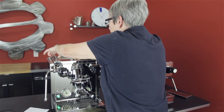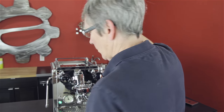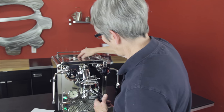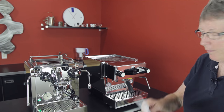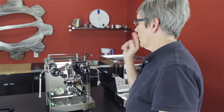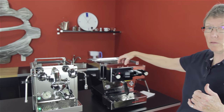On this one with the PID, this is where you switch the water source. True double boilers: 1.7 liter on the steam side and 0.58 liter on the brew side. Copper boilers with brass end plates, insulation wrapped. This has an E61, which keeps the stability of the temperature at the brew head, versus the Linea Mini which has the boiler sitting right on top of it.